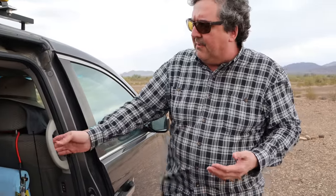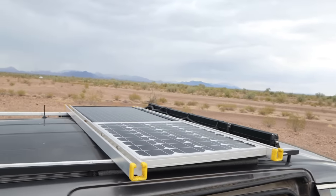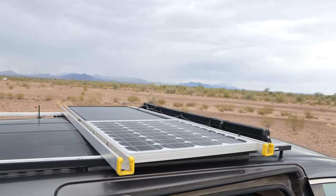The Renogy controller will charge the house battery off the alternator while I'm driving — I think it's a 30-amp — and it has a built-in MPPT controller for the 100 watts of solar on the roof. The nice thing is when you're parked and the house battery is charged, it'll actually charge the starter battery. That leaves the capability for me to park the van for a while in a different location and maybe fly in and out depending on where I need to be.